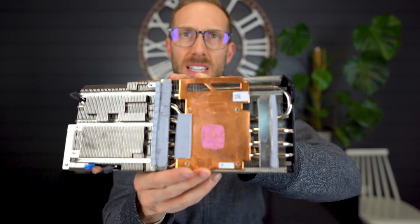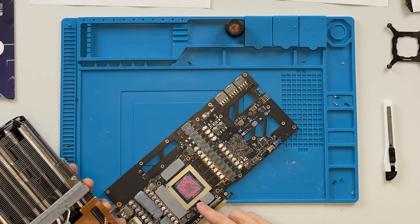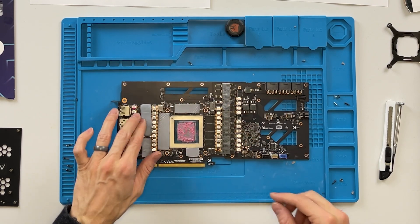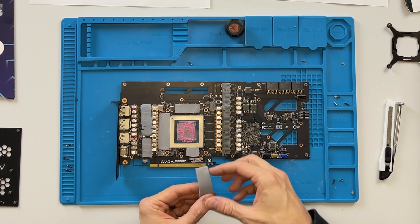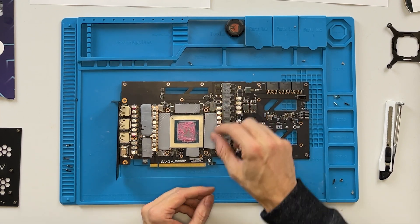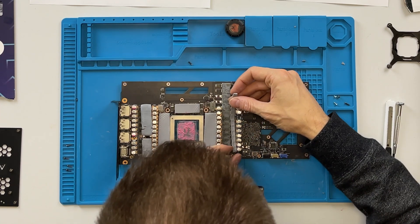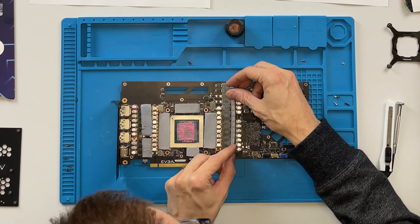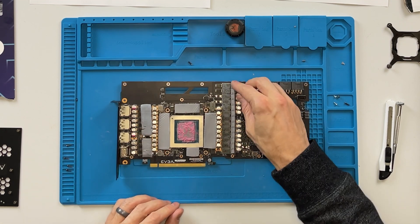Here's an example of what I mean by the GPU paste - yeah there's a hole in the middle there, but there's actually coverage for it. I may need to reapply since I've taken this on and off quite a few times now. Ideally you put it on once and leave it, replacing it after each go. Just to point out what I have done: there's a part on both sides here - this is the 2.5 millimeter that I put on the VRAM pieces. The 3 millimeter were actually for the tiny little chips all along the side here. I actually don't know what they are - if you know, please leave a comment below. I'm going to replace all those with 2.5 millimeter.